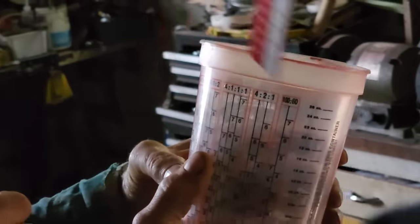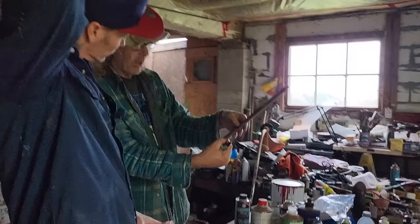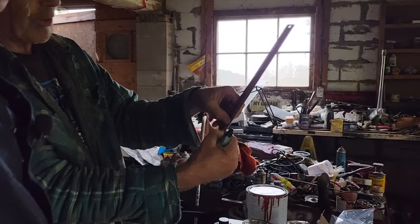No, because the big can is bigger around. Oh, yes, yes. You'd have more can. But also, I got more paint because it's bigger around. Right. And I got more reducer because it's bigger around. So you could do it on this stick. You could do it if you had a straight up. Okay, if I was doing it on this stick, I'd go 4 parts paint, 1 part reducer, 2 parts. Exact same thing. But I'd have to have a square can. Right. Or something, like in my spray can. I wouldn't be using that angled thing.